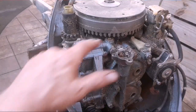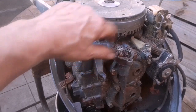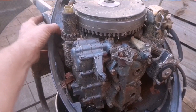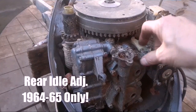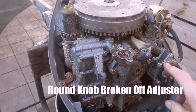Just a few features that the later models didn't have: it's got the magneto ratchet spring attachment in here, another idle adjust here. No idle adjust on the tiller — that came out in '68 I think. So you actually adjust your idle here with your mechanical idle, done right here. And you've got the old style fuel pump. That'd be amazing if it still works — we'll see.